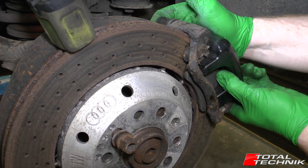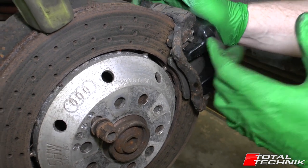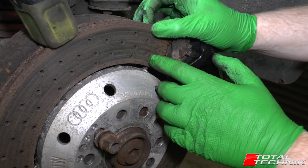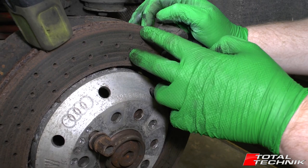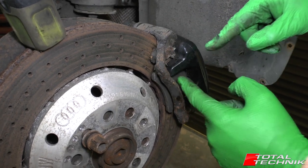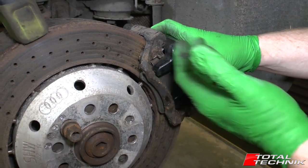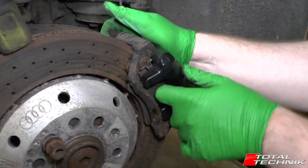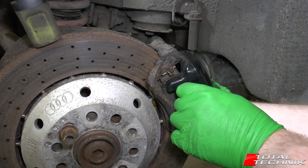With the handbrake released, we can feel around and see how tight it is — there's a little bit of movement there. A lot of people think these discs look particularly bad, but you're not trying to release the brake pad from the brake disc; you're trying to release the caliper from the pads. The pads can stay in situ and they most likely will, especially if you've got a large pitted edge. So don't worry about that — just feel around and slide the caliper off.